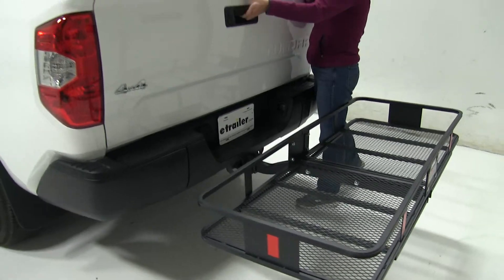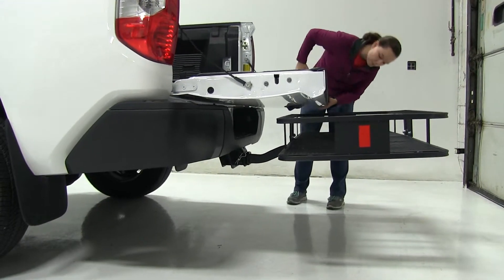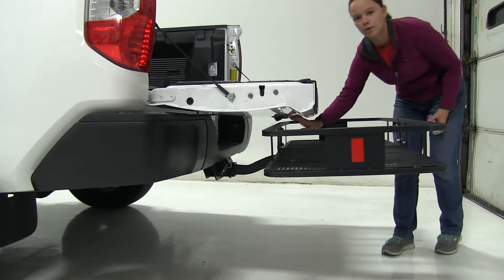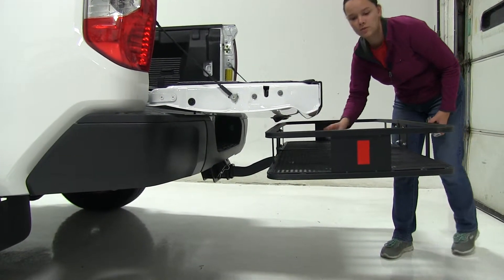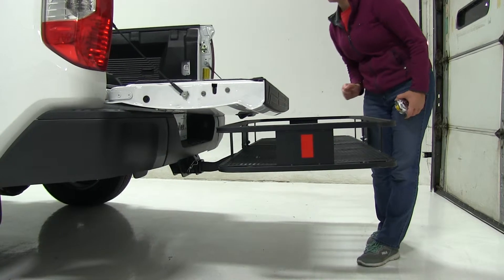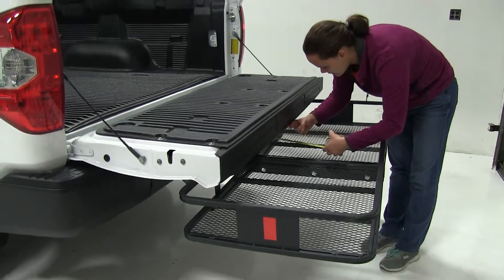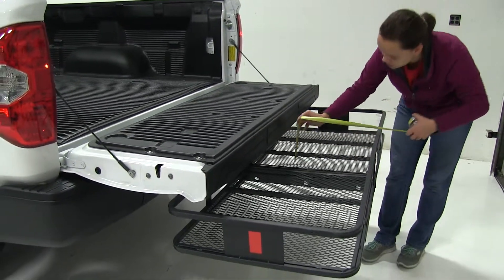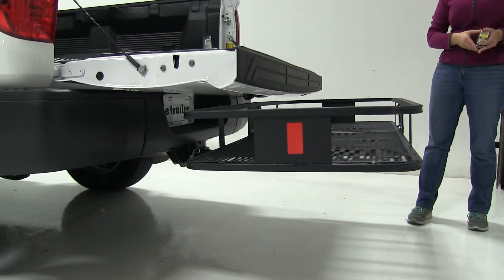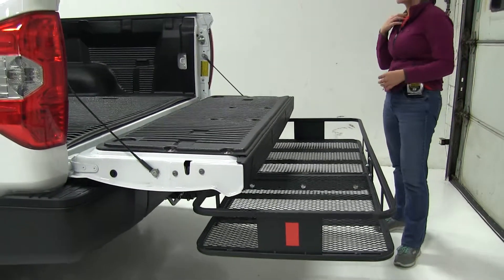The next thing we'll do is check our tailgate overhang and break over point. You'll see that we're not going to have to worry about it making contact here. We even have a back up camera on that handle area, but we still have enough room between the outer edge of our carrier and that back up camera that we're not going to have to worry about contact. This hangs over about seven and three quarter inches and is off the platform at about six and three quarter inches. So just keep that in mind — if you have any materials stacked up, you might want to move them out of the way to gain full access into your truck bed.